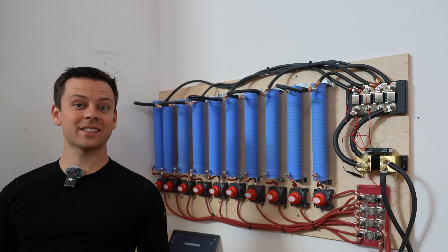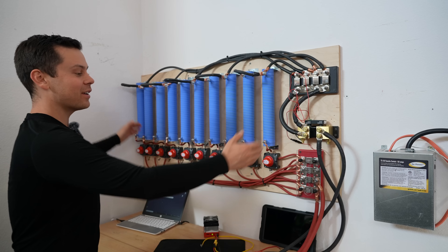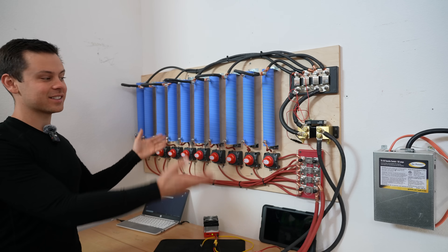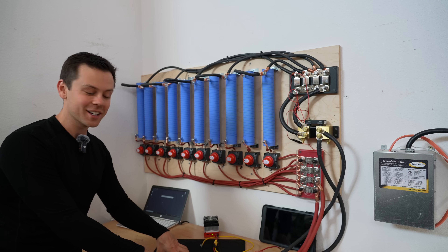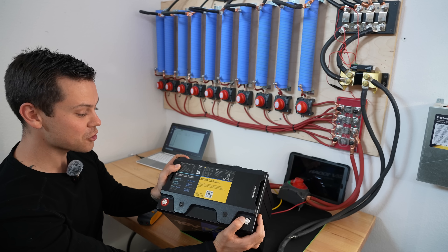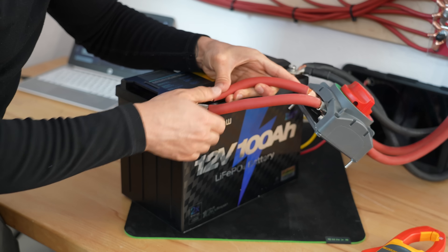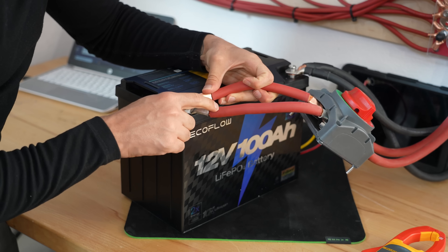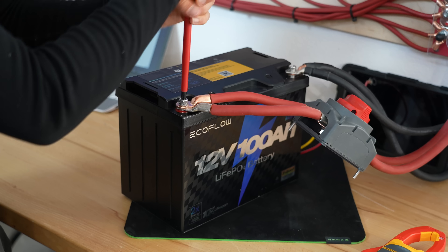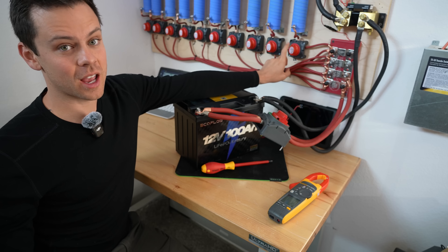We've been testing the surge capacity of 12-volt batteries with a huge resistor bank, but it's very large, very heavy, and hard to film. So I created this test station — slapped it on the wall. We can put a 12-volt battery down here, hook it up, and see if it works. We've got our Fluke meter and some big cables. This is a great test to see if you can put big cables on a small battery, and it fits — some batteries make that very difficult. This battery is fully charged, and we're going to give it 300 amps.